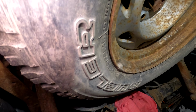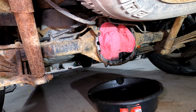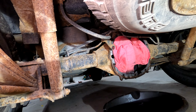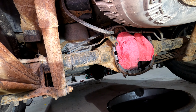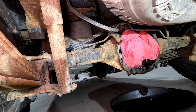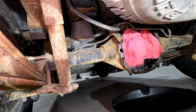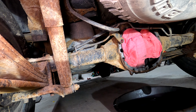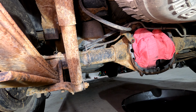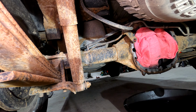And now it's on to the differential. Get that sealed up. It's drained overnight. It's as empty as it's going to get. I'll get the sealing surface cleaned up, and then we'll get the cover on. Let that sit for a bit and get her filled full of fluid. Then I'll be moving on to transmission cable. Got to get the interior, get the old transmission cable out.